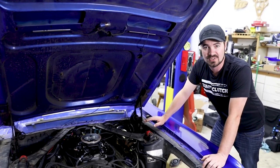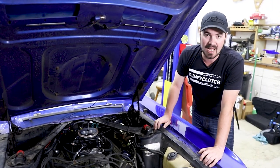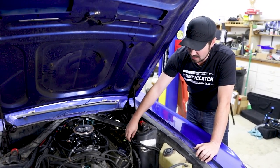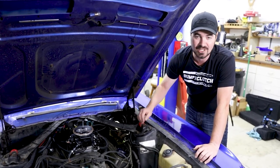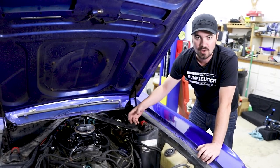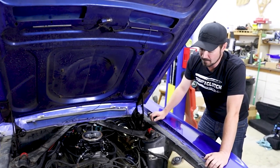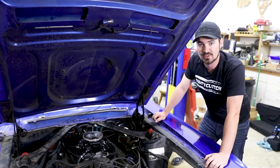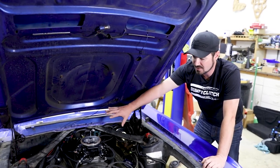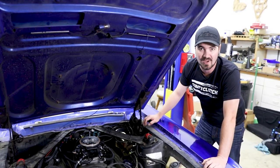It is the brown wire for those of you with a 67 Mustang, catching it before it runs through the factory regulator and back to the starter solenoid. So far it seems to be a perfectly good source, although I do not like having a splice in the old brittle harness in the engine bay. I will probably be recutting and splicing this entire loom with more modern connectors and making sure it's more weatherproof going forward. Overall, I haven't had any electrical issues with the unit, and the overall wiring required essentially four or five wires.